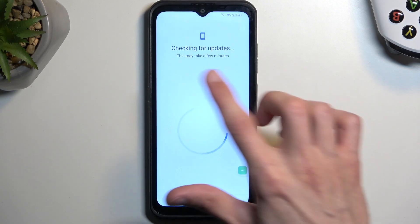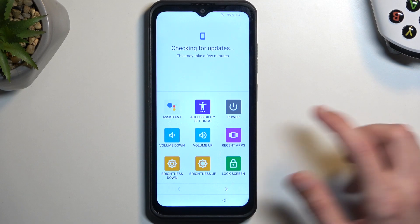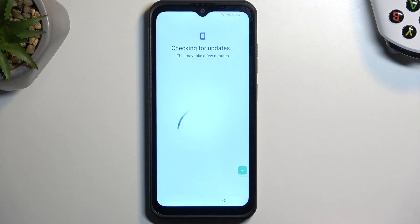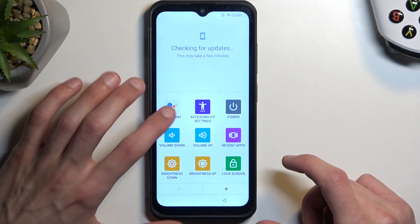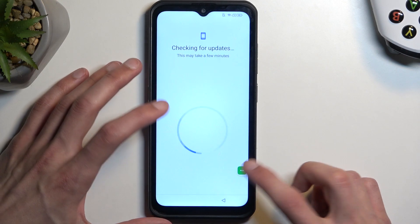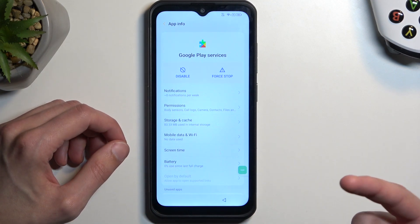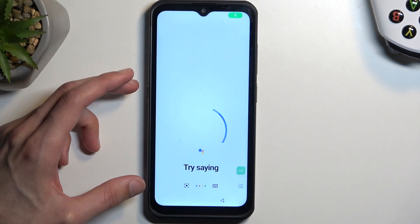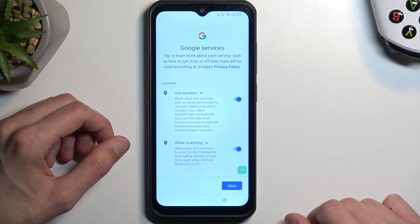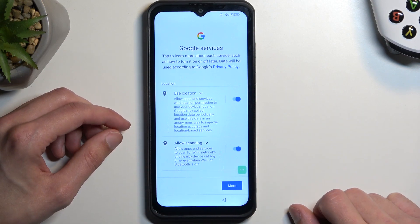What will happen now is it will start checking for updates, then glitch for a second, and go back to checking for updates. What you want to do is tap on the overlay, select Assistant — this brings up Settings — and pressing Settings will open Google Play Services. This might take several tries since it doesn't always work. Keep repeating the process until it gets you where you need to be. Once you enable it like this, go back once. Click somewhere on the display to dismiss Google Assistant, and as you've just seen, it automatically skips over the verification process.